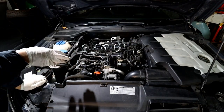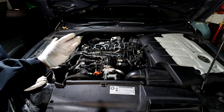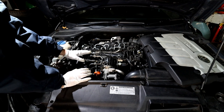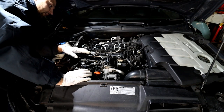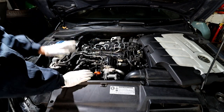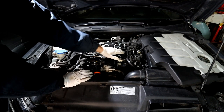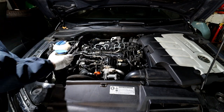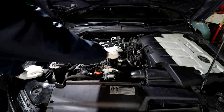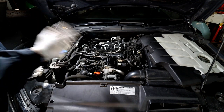You might look at this and think your 2L TDI engine doesn't look like this — you may have a different year, but don't worry. On this engine — I'm pretty sure it's the CBD engine — you've got the glow plugs here with little connectors: one, two, three, four. I've got an issue on one, three and four. The camshaft is on this side and the count starts from this side, so number one, two, three, four.